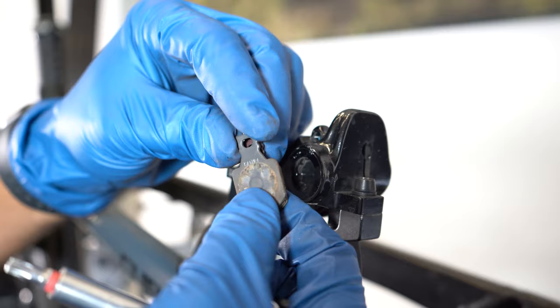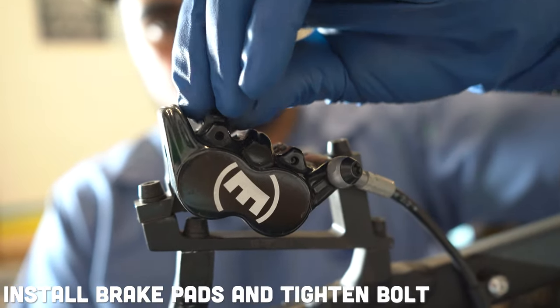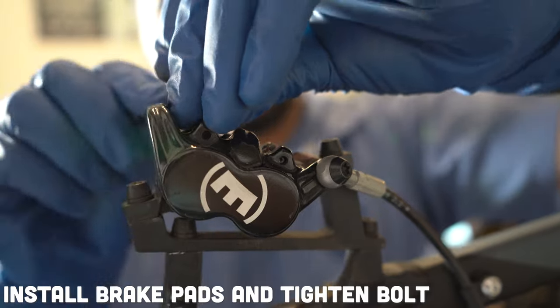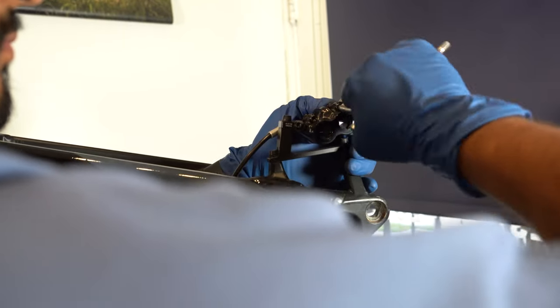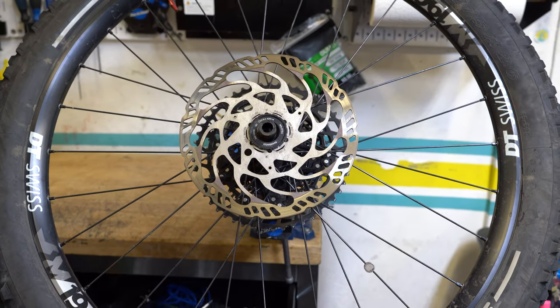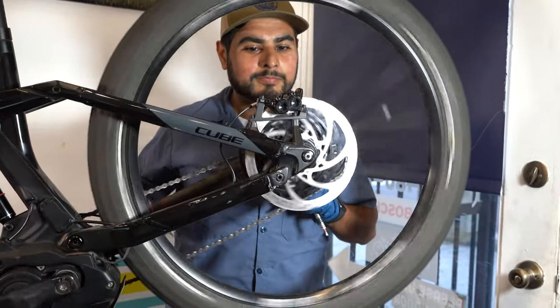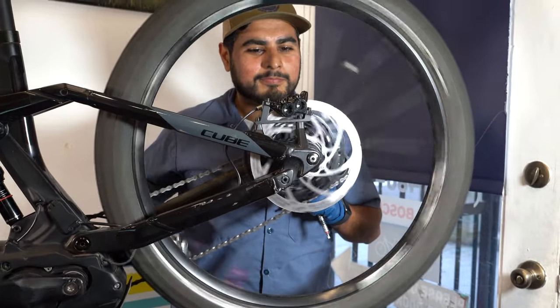You want to adjust this as well once you put the new brake pads in. Next, install the new brake pads and tighten the brake pad bolts to spec. Next, install the wheel. After the wheel is installed, go ahead and press the brake lever so that the pistons match up against the brake rotor. This is important so that you can make sure that there is no rubbing between the brake pads and the rotor. Give the wheel a spin, and if all is silent, you're good to go.